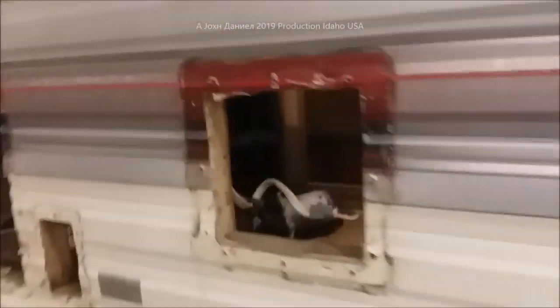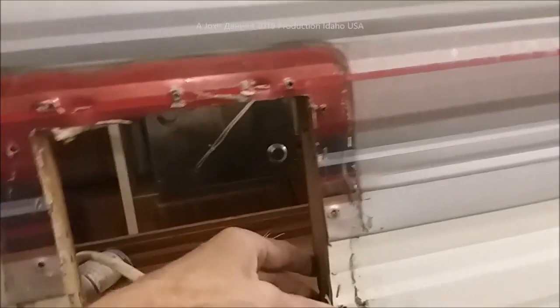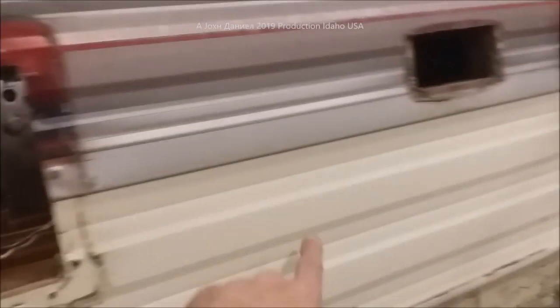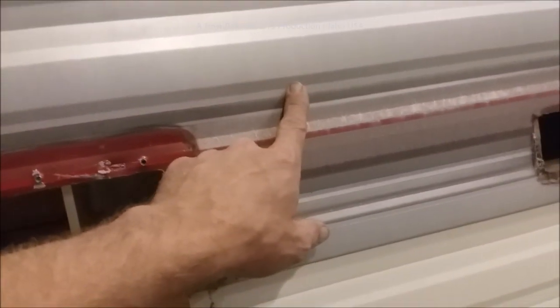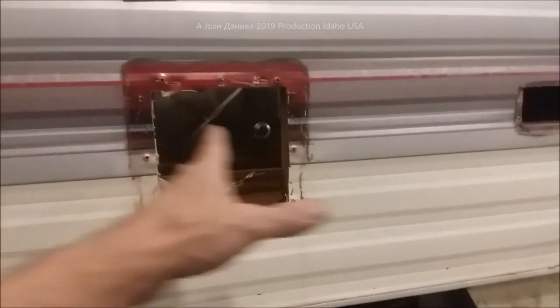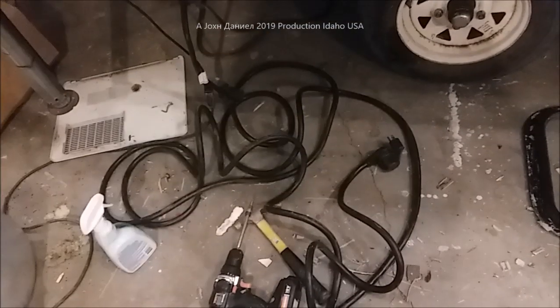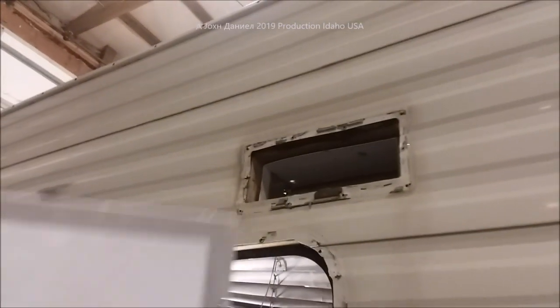Where the original electrical was behind the stove, there's about nine and a half inches of depth before you get to the stove. We're going to fit about six 35-amp-hour batteries in there — I'll cut a larger hatch to access them, add a couple of small vents, and box them in. These are sealed lead-acid UB12350s. That location originally had a very heavy 25-pound wire in there, so we're doing a lot of things to reduce weight. We'll also be putting in a brand new hood for the stove.